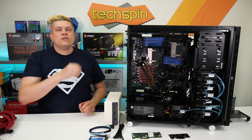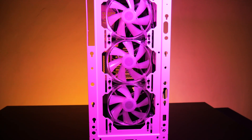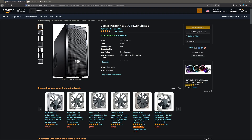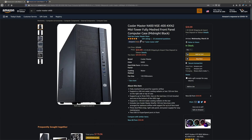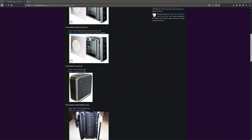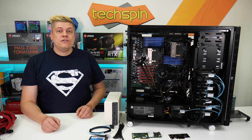Drives inline with the case will make your job hard, with motherboard or wiring making back access tricky, and likely poor front access with case metal or fans blocking the way. 5.25-inch hot swap bays may look cool but can be 90 bucks a pop. The cheapest option we saw is a Cooler Master N300 or N400, though drive installation with an ATX motherboard installed may be hard. DIYmediahome.org has a list of old huge-bay cases, and a great one is the Thermaltake Core V71 at $170, but all these are discontinued. We'll cover a great new case next episode.